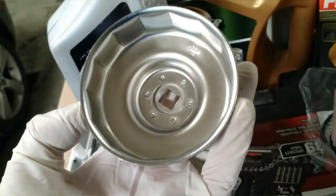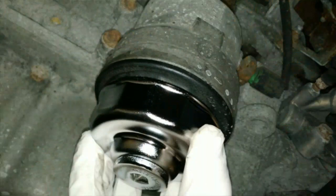If you use a universal tool or a strap wrench where there's uneven pressure, anything that causes a gouge in this plastic housing is going to lead to an oil leak that you can't fix. Then you're stuck with a car sitting in your driveway and an oil stain. This has happened to me personally, so I can't stress enough — don't let it happen to you.